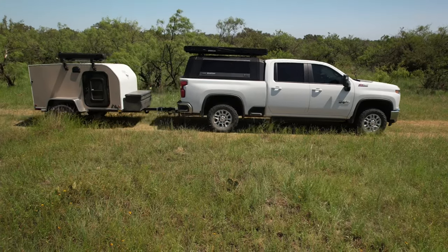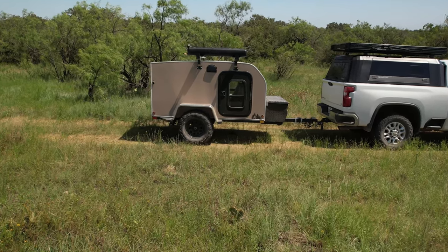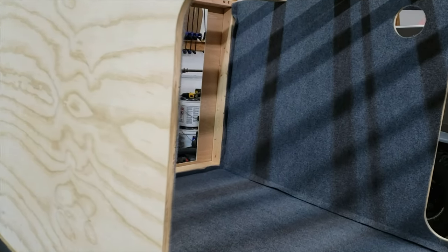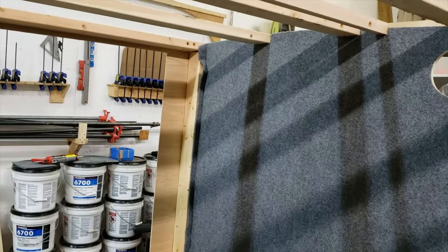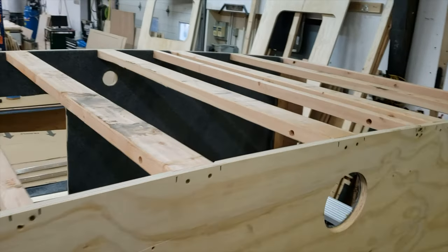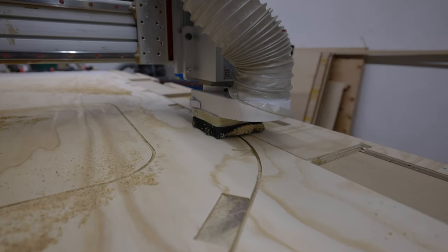Kicking things off, you get a five by eight foot interior, which is plenty of room for adding all sorts of custom goodies. This is an aggressive off-road model, so you're getting 31-inch 1050 R15 tires and heavy-duty aluminum fenders with a batwing step on both sides — this thing is really beefy. The trailer comes with a straight Dexter axle and 1400-pound leaf springs on each side. The walls and floor are made of three-quarter inch exterior grade plywood, covered with carpet on the inside, and the ceiling is a beautiful mahogany plywood constructed with two-by-four ribs about every 12 inches.